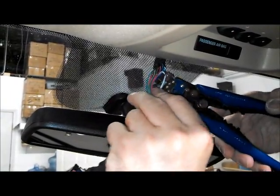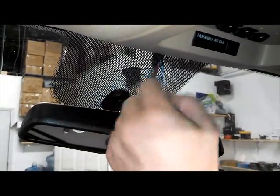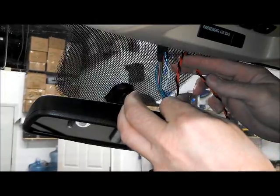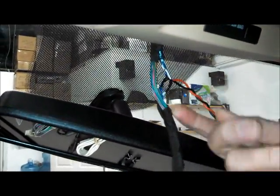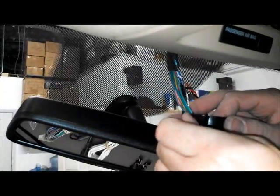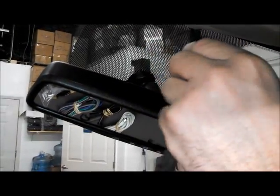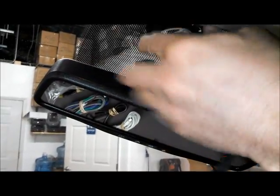That's why I like these style strippers — I can go ahead and open up that wire right there and get to it. I'm going to make my connections with the red and black wire after I trim it down. The connections are red to white, black to blue, and I've got them both taped up individually. What we're going to do next is get our harness looking decent — just take some black electrical tape, wrap it nice and tight around the front with the wire going. We're going to want to tape this up as far as we can.